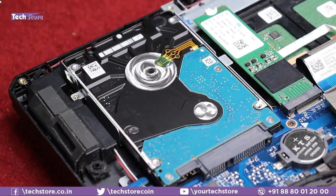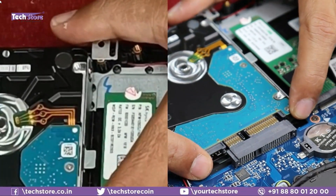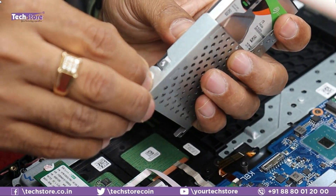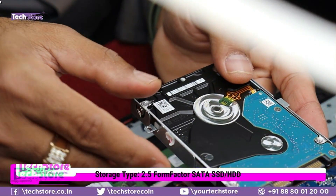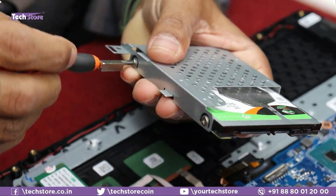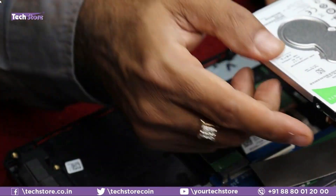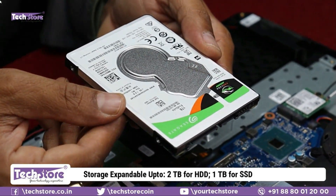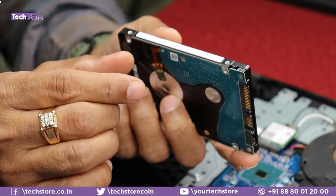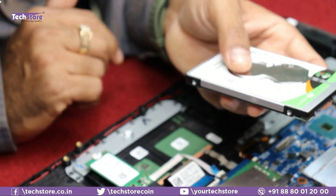The hard drive is held in by just a small notch — pull it out and it comes off. There's a casing that connects to the hard drive. To replace it with an SSD or a new hard drive, use a 2.5-inch form factor SATA SSD or hard drive, up to 2TB. Remove the screws, the frame comes off. Both slim and thicker drives are accommodated since the block is quite thick.